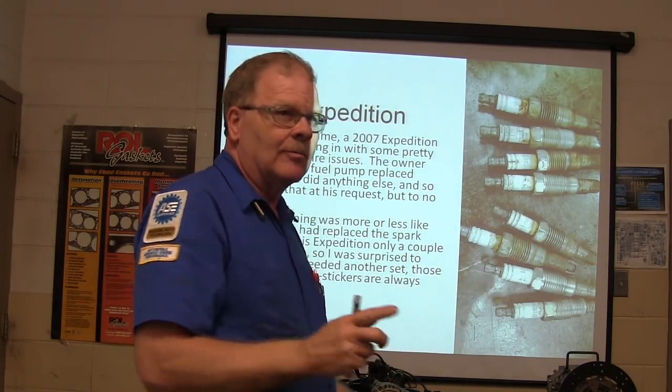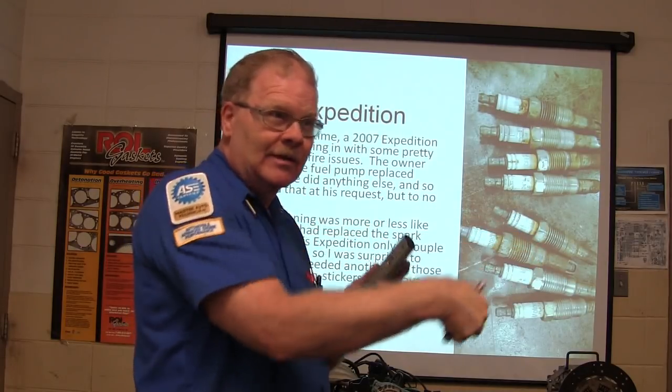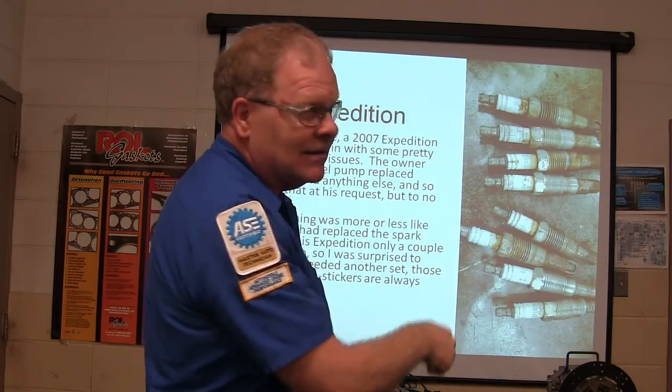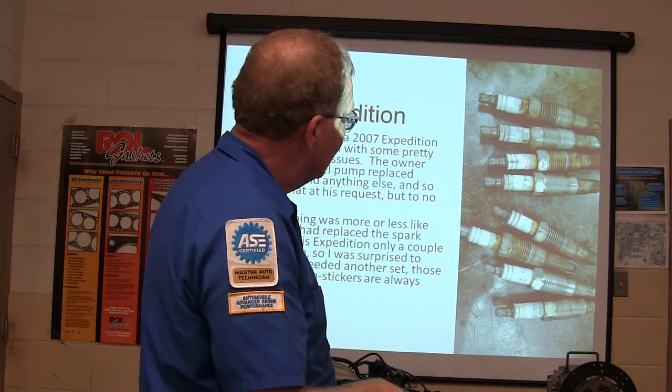Yeah, hard to get to the back one. That's why we use the 90-degree impact wrench we got over there. You put a socket on it, and that was a 9/16. Now it's not a 5/8. You got to remember that. You put it in there.